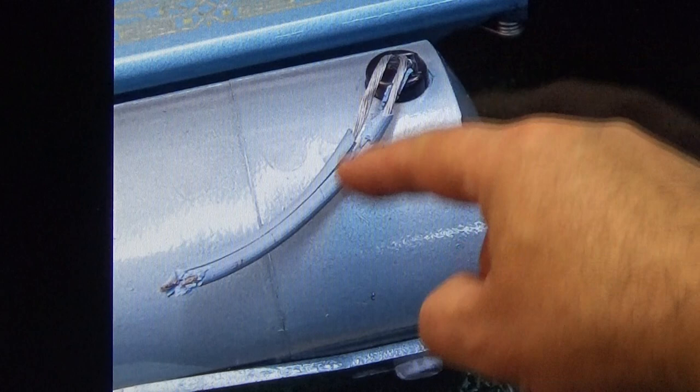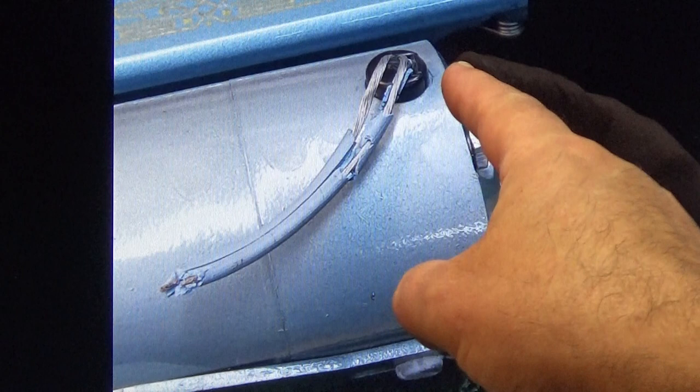You can see bare wires right at the bottom of the motor coming out the bottom. And again, as a motor is mounted, this is going to be on the bottom. It's going to be out of sight. So that's why it's always wise if you buy a machine, particularly a Japanese clone machine post-World War II, before you plug it in and try to hit that foot controller, do some basic inspection of that machine so that you know that it's safe to operate. And that's true of any machine, not just post-World War II Japanese machines, but all sewing machines for that matter that are vintage. You always want to do a general inspection to make sure that it's safe to operate, okay?